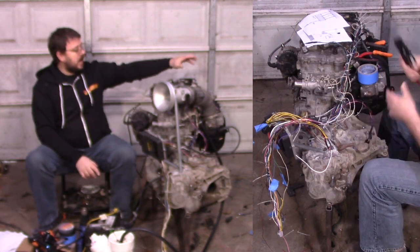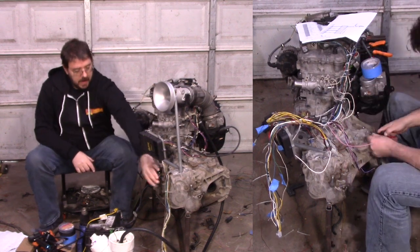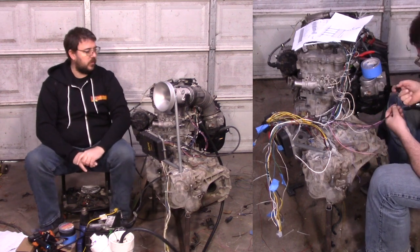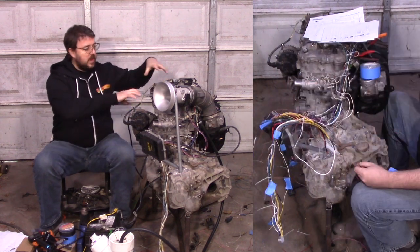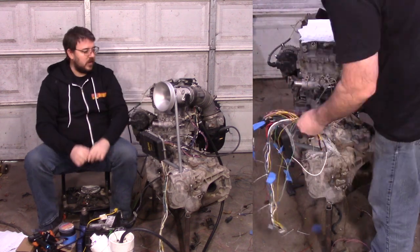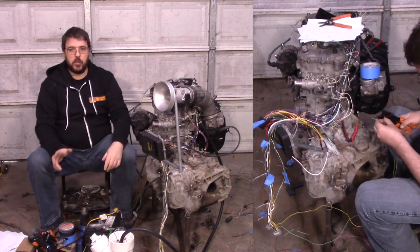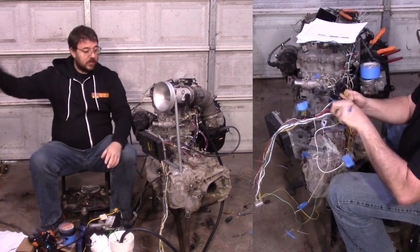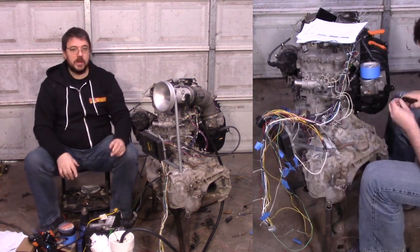I will be making a second wiring harness so that both race cars use the exact same wiring with the exact same pinout — it'll make debugging easier in the future. I do like making wiring harnesses like this on the actual engine because it gives the wire the proper shape, so you're not manhandling it later. There are ways to build motorsport harnesses with more flexibility, but that's a whole other level of equipment and time than I'm willing to put toward this.